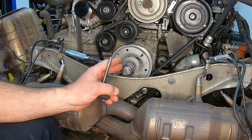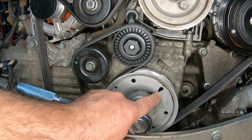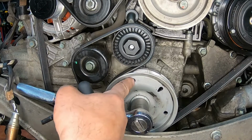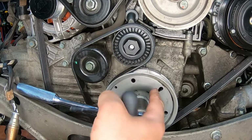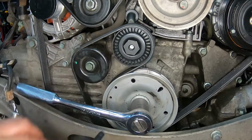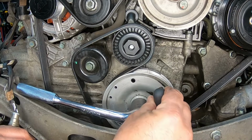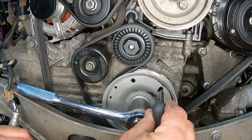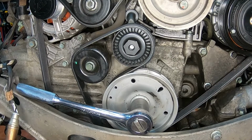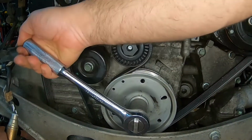All right, so the first step is to locate on the crank pulley this one mark over here. All of them have circles, this one is oblong, okay? And you want to put this right here. There is going to be a pin, this is the pin that comes in the kit, I'm going to go over it in a minute. It goes in and connects into the block around over here. So I'm going to spin the engine around so we can put it in the right position and start this job.